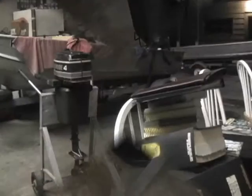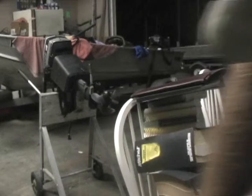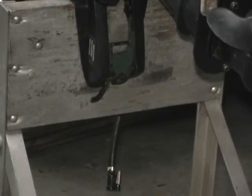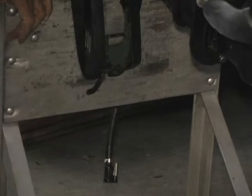I'll be right back. There's a tilt adjustment under here. Bring it up, and let's see if you can see that thing. There's a little tab on the bottom of the transom bracket. Difficult to see, I'm afraid, and my battery from my light's about done. Right there. That thing lifts up and out, and sets down in various angles so that you can adjust the running tilt of the outboard.